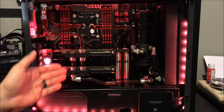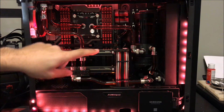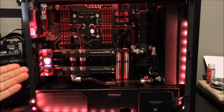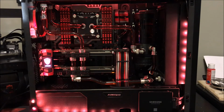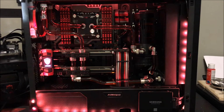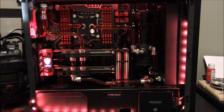I did notice that there was no coolant on this side, but I figured by cycling the pump a couple times, I could force air through the system. So when it was running for a little bit, I turned the fans on max, the fan controller on max, which also controls the pump, and it wasn't moving the air bubble. And as a result, this card got up to 91 degrees and completely started thermal throttling. Just from normal operation. I wasn't stressing it or anything like that. But it had a little bit of load just from playing a YouTube video or something like that.